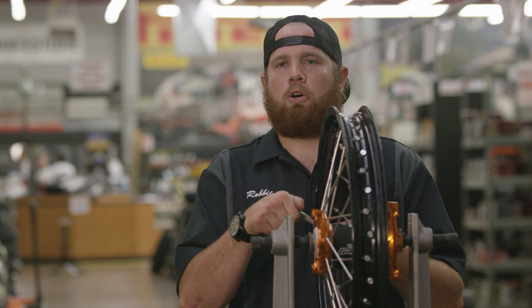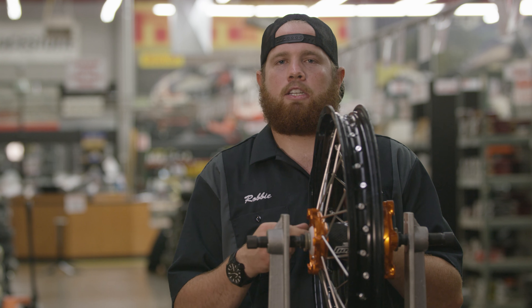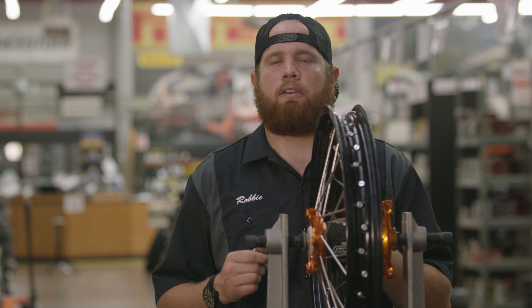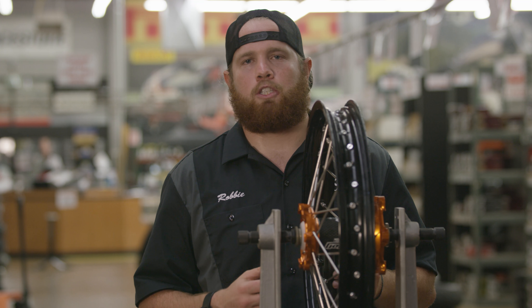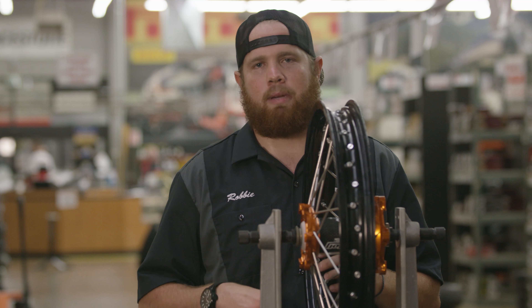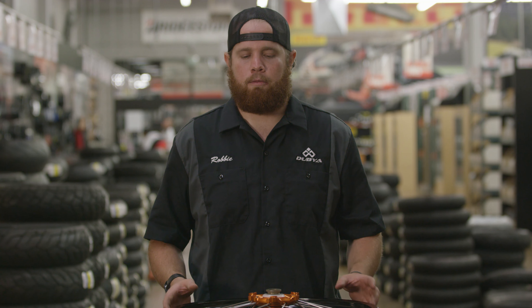If you don't have a torque wrench, what you're going to want to do is tighten it fairly tight. You don't want to be putting your whole body into pulling that nipple down. What I would generally do is just put your thumb on a regular spoke wrench — one like the one that comes with the bikes. You can put a little bit of effort into getting it down, but you don't want to be cranking on it as tight as it can be. The spokes need to have a little bit of flex in them. That's the benefit of a spoked wheel — they get a little bit of flex and movement.